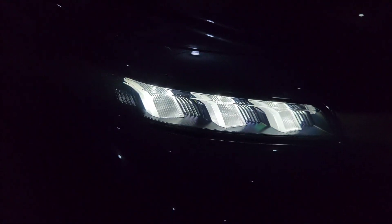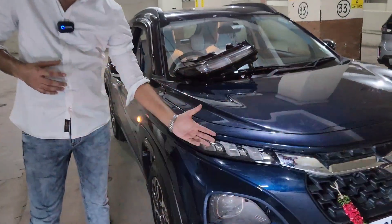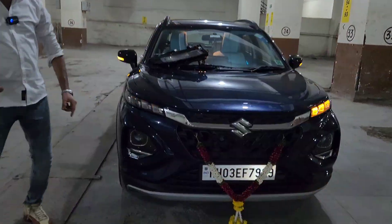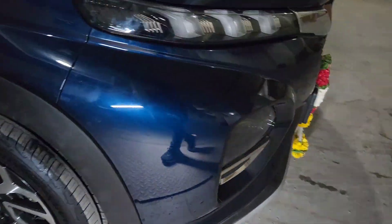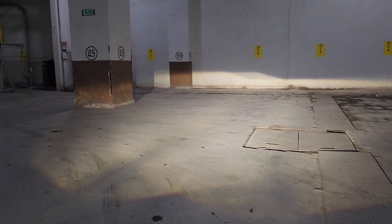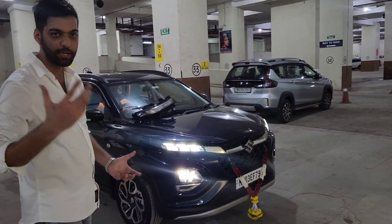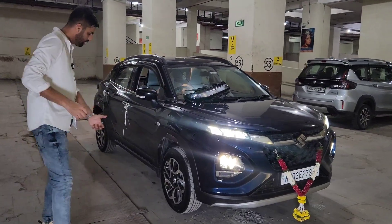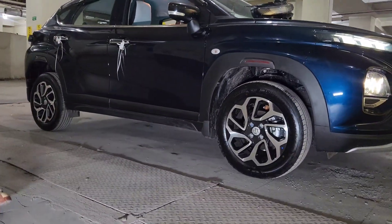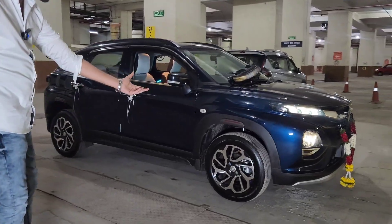You can see it — it auto dims at night. It is bright. See the look of my DRL indicator, which is orange. You can see the look of the whole car with the DRL. The headlight, which was a halogen from the company, we put in the LED in yellow color — 4300 Kelvin color temperature LED — which gives focused light. The fog light warm white light works better here. And with the DRL in front, the 16-inch Nexa Genuine Diamond Cut Alloys complement the side.